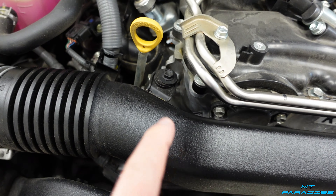With the duct out, go ahead and remove the MAF sensor. First, unplug it — there's a little tab you push down, then pull it off. There are two tabs holding it onto the airbox, including one behind it, so use a little pry tool to pop those off. Then unscrew the MAF sensor — two Phillips screws. Be careful with it, don't drop it. Set it aside.